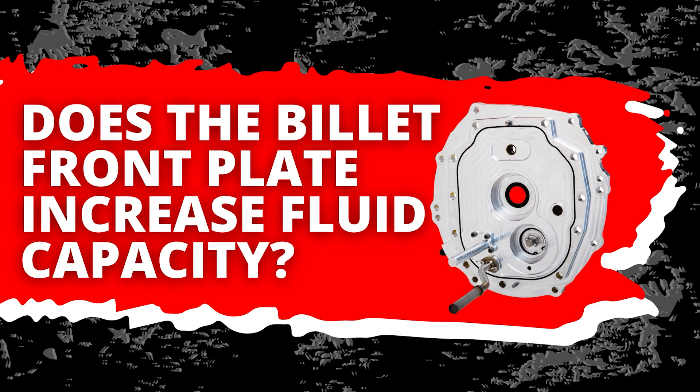It's enough to run a cooling circuit if that's what you want to do — plenty of volume at idle to do the circuit portion of things. From about 2,500 engine RPM up, it's going to spray really hard. If you were running a cooler with a cooling circuit, you would have to have more fluid in it to make up for what's in the lines and in the cooler at all times. That volume is going to be dictated by where your cooler is and how big it is.